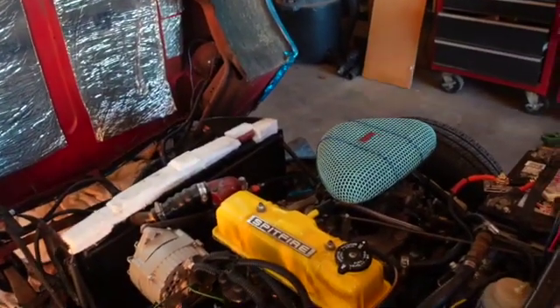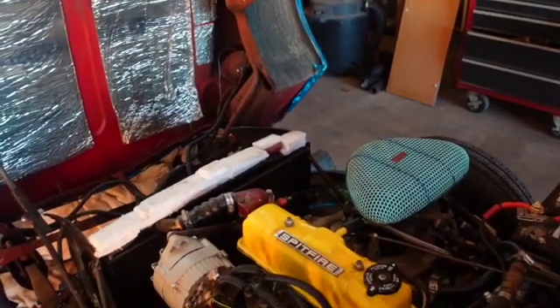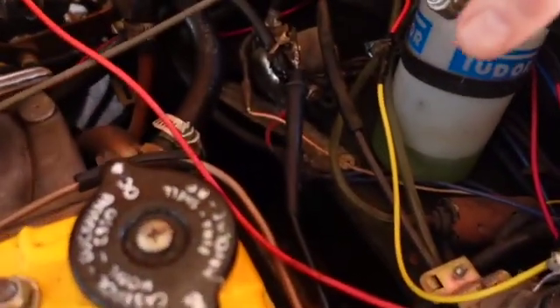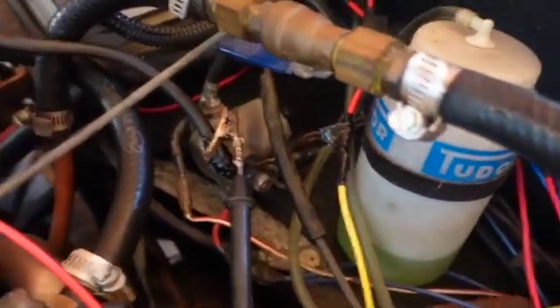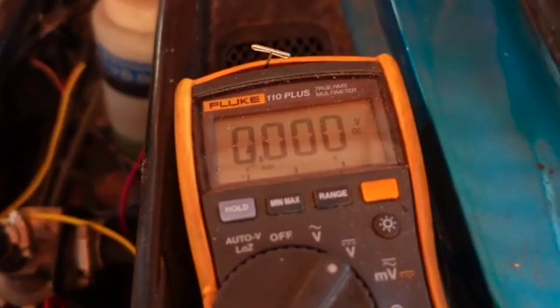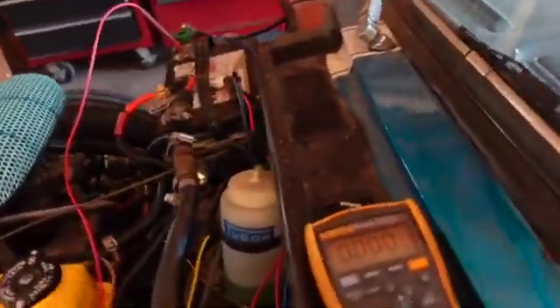I'm still not going to take it out. I can't get out here — it gets too late, so I don't like taking this thing out even at dusk because it's too hard to see. I turn the lights on all the time anyway, day or night, because it's so little. Okay, so it's going to come up negative — doesn't matter because this just has the alligator clip. I've got the alligator clip on the R-terminal, and I've got it on the earth part of the battery. There's no key in it — see the empty keyhole? So when I hit the ignition switch here, we should get voltage. I'm guessing 10.5 to 11, because we're under a load. Let me make sure I'm out of gear. Okay, out of gear. Okay, 10.3. That's good enough.